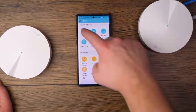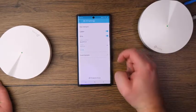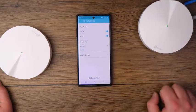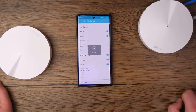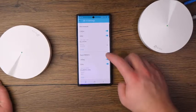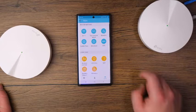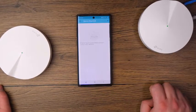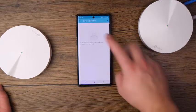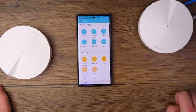Clicking on the grid icon at the bottom, you can see Wi-Fi settings where you have the 2.4 and 5 GHz bands — you can toggle them on or off, change the network name (SSID), or the password. You can enable a guest network if you like, though I prefer to toggle that off. Going back, you can also test your internet speed right from the app, and you can blacklist certain devices — if someone is trying to do malicious things, you can blacklist them so no matter what, they won't be able to connect.